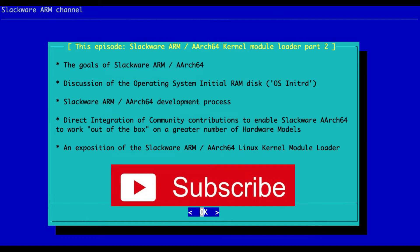My BananaPi wouldn't boot, so I disconnected the BananaPi I'd been testing Slackware ARM 15 beta on and pulled it out without shutting it down properly. I plugged it back in because I needed that machine booted and it still wouldn't boot. So I pulled the U-boot card, disconnected the hard drive, and thought I'd replace the entire BananaPi with the other one — the great thing is the configuration lives on the SD card, so I can extract it from one BananaPi and plug it into another. But that one didn't boot either. It turns out it was just one of the cables in the back of the UPS that wasn't properly home — I pushed it a little more and it clicked in.